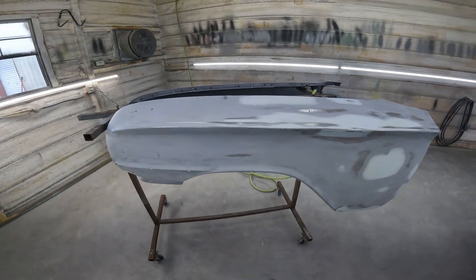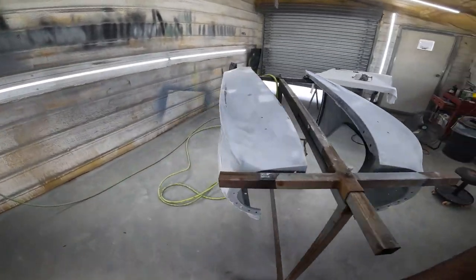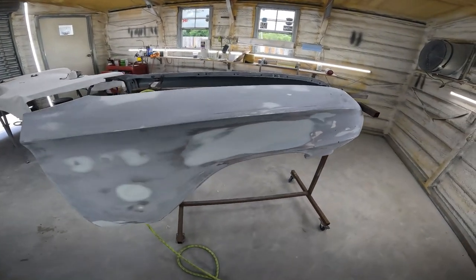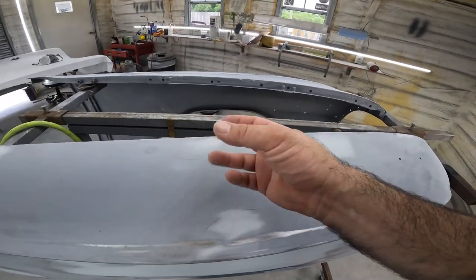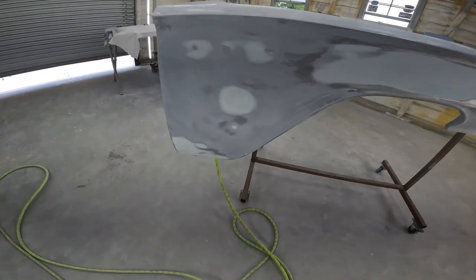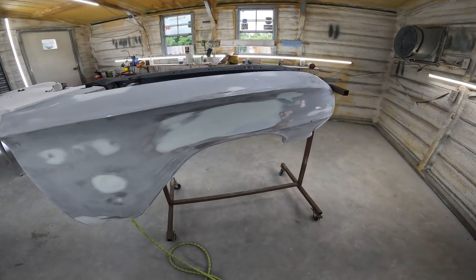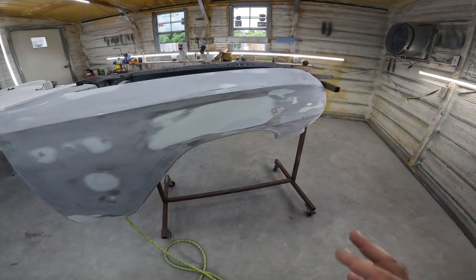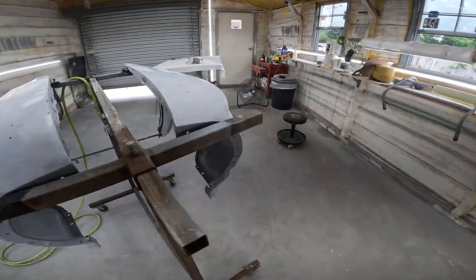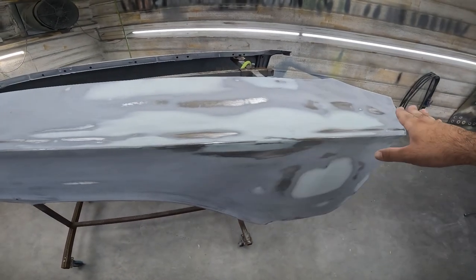Here we are, it's about three o'clock, and these fenders were a lot more work than I was anticipating. I wasn't anticipating near as much body work, but once you put the block to it you really find some spots. It seems like from the factory this area right here was wavy, probably from the way they welded. Same in the back - a couple little dingers, a little bit down there, but not too much. It looks like a lot but it's not. The main area is this - it's probably going to need another skim. Right now everything is in between 80 and 180, mainly 180. This little pinch that was right here turned into this whole thing.